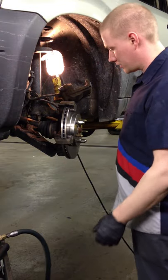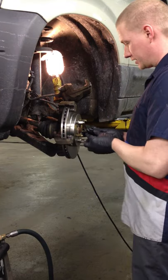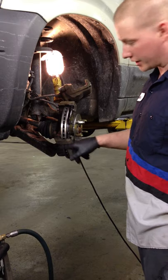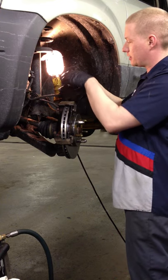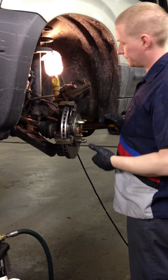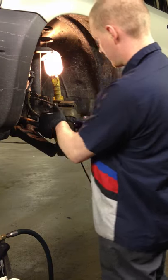We're at 47-115 — they've got lock plates on them. I take the outboard pad — nothing on it, dry — it just falls in here. As you can see, the rotor's not flopping anywhere; this one's easier to get on the bracket and just sits in there perfectly. For speed you can do it the other way. This one just snaps into the hollow part of the caliper — get all the ears in there and you can see the ears where they slide on the bracket.